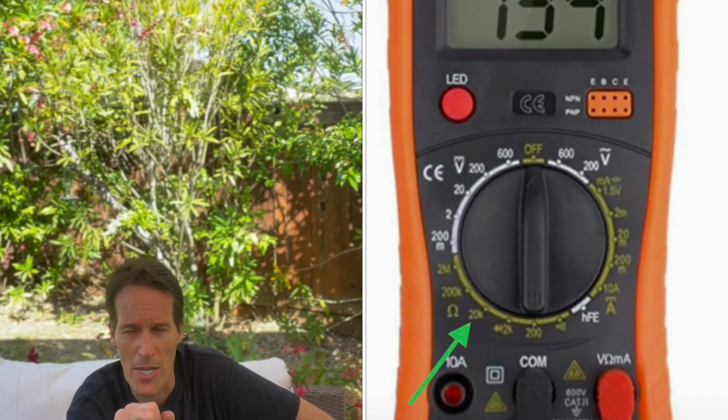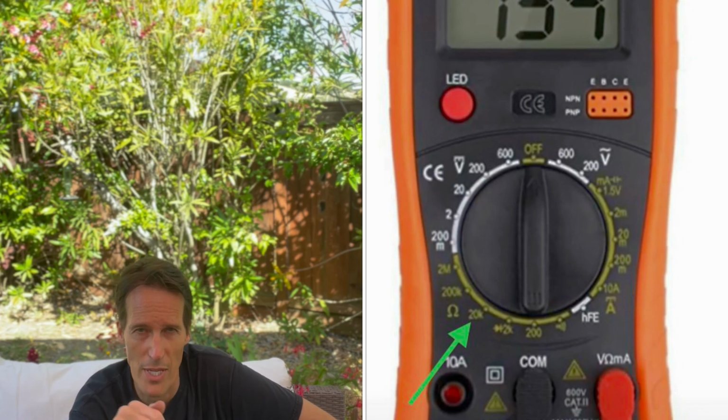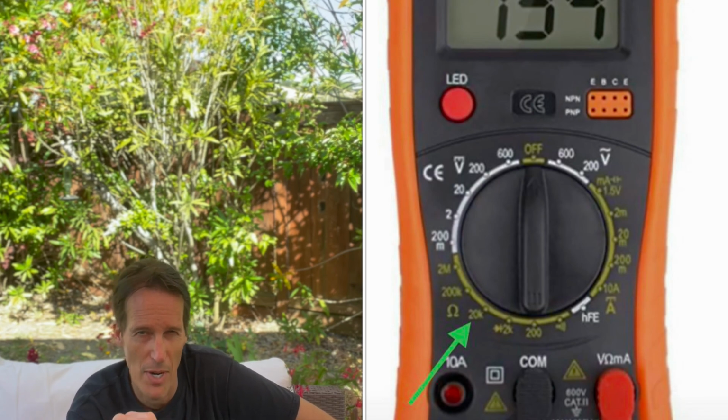So if you can get a multi-tester, it's a really good tool. I'll put a link in the description below for one that's about 12 bucks on Amazon. Really easy to use. It can tell you if current can flow through your thermal fuse or your high limit. If it can, then you know that that piece is not the problem with your heating, that it's something else. So we're going to go over how to replace that in the links below, and also I'll give you some different parts you can get really cheap.